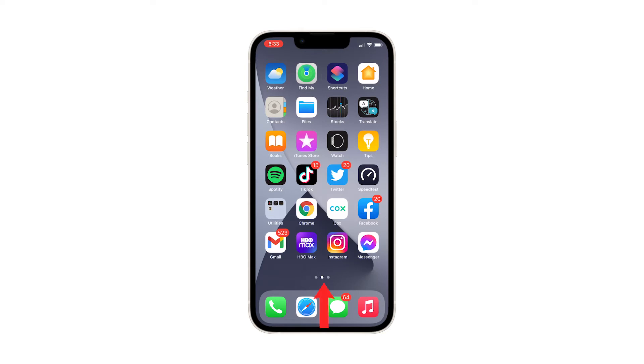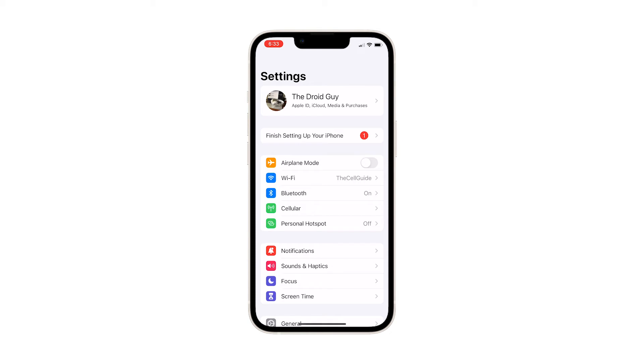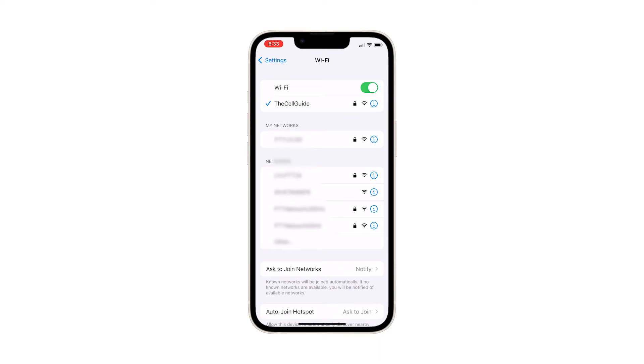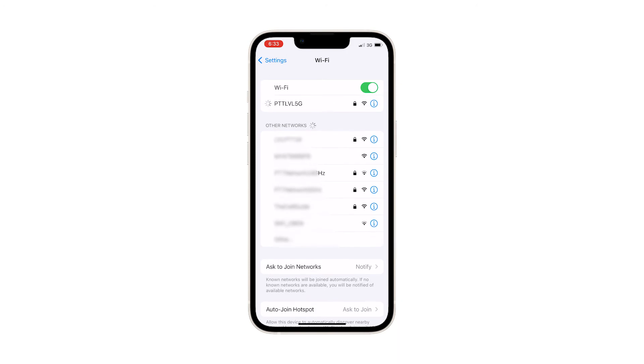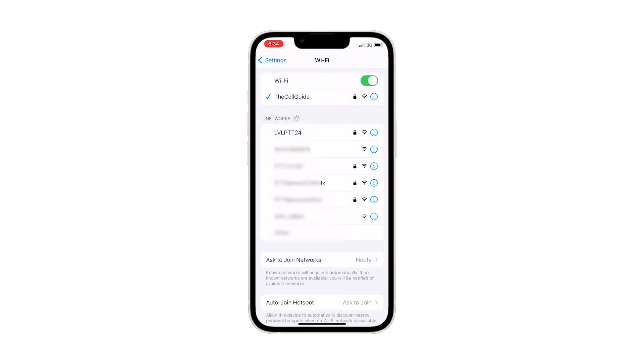Here's how it's done. Go back to the home screen and launch the Settings app. Find and tap Wi-Fi. Look for the Wi-Fi network that you want to delete and tap the information icon next to it. Now tap 'Forget This Network,' then tap 'Forget' and it will immediately be deleted from the list. Now reconnect to the same network. Once your iPhone 13 mini has reconnected, try doing a speed test to know if you have a stable connection.